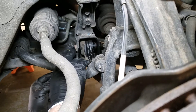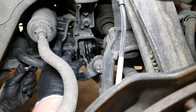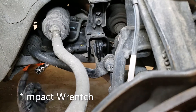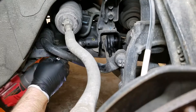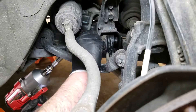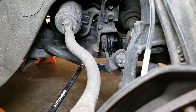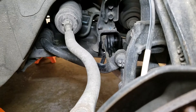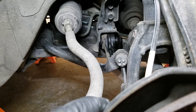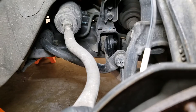17mm. Get as straight on it as possible. You could do this with a ratchet, but since I have the impact, that's what I'm going to do. Now, with your pry bar, wedge this out a little bit — while keeping the axle in so it doesn't come out. As you can see, you can move this — I'm just grabbing the rotor right up here. And you can move this around. That's exactly what you want.